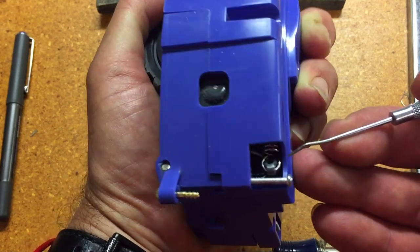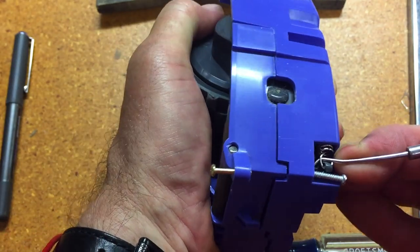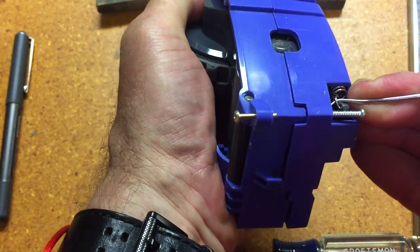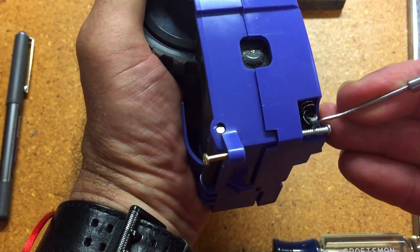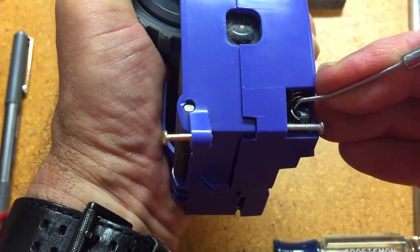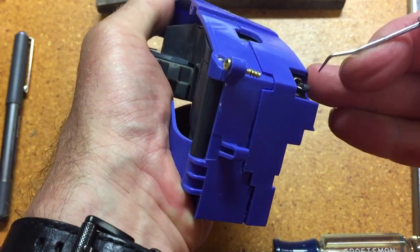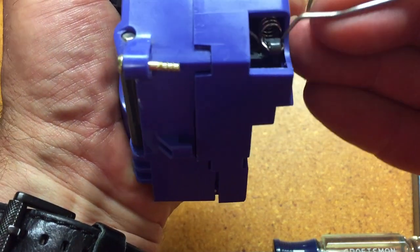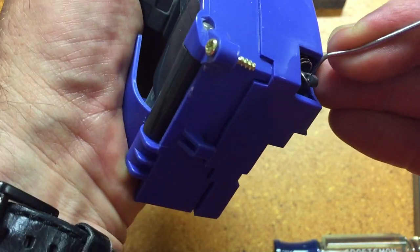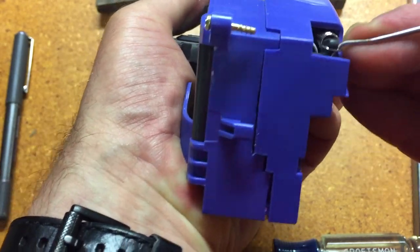The way this is designed, with this spring coming into this hole here, it kind of gathered — they expect it to be done from this end. It's under quite a bit of tension, considering it's just a little floor cleaning robot. I'm not positive whether this tool I've got in my hand is going to be adequate. But definitely you want to do this before you take those screws out. There's a good likelihood of messing up the electronics in the module, and in that case it'll be toast for sure.